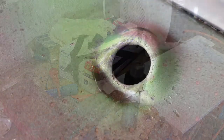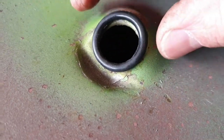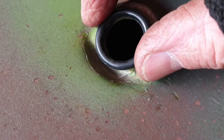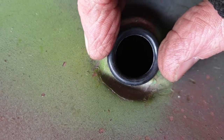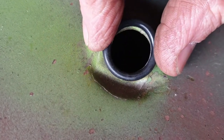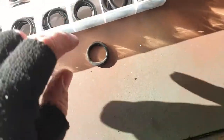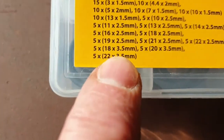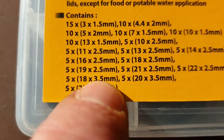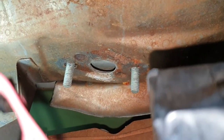Right, back over at the car. Two O-rings here - I've got one that will sit just lovely on the hole like so. The size I'm going to go for is this one which I think is 18 by 3.5 millimetres if that helps somebody out. Here we go - there is the hole and we've got to get this bugger up in there.